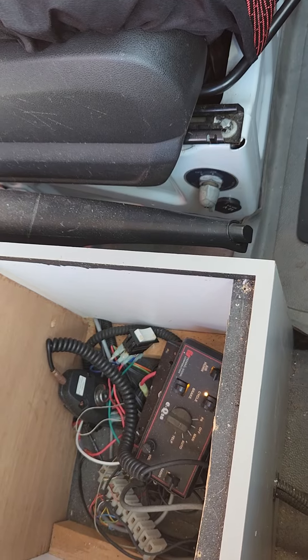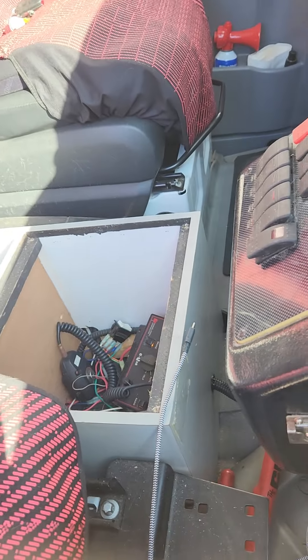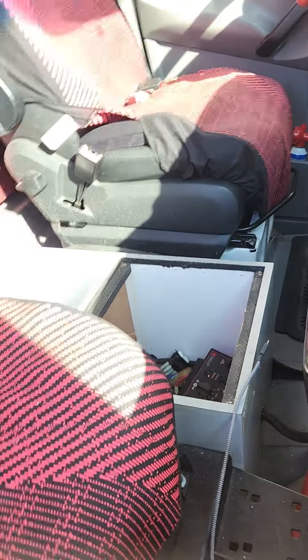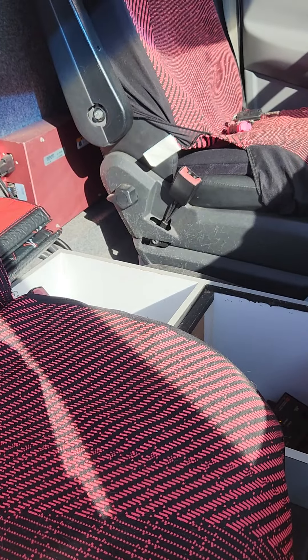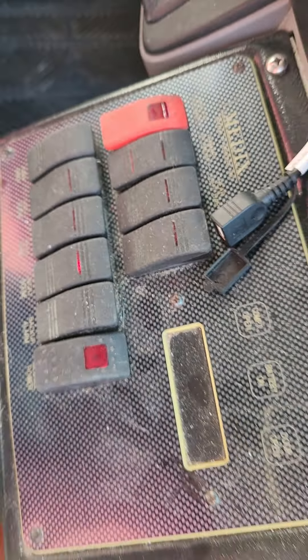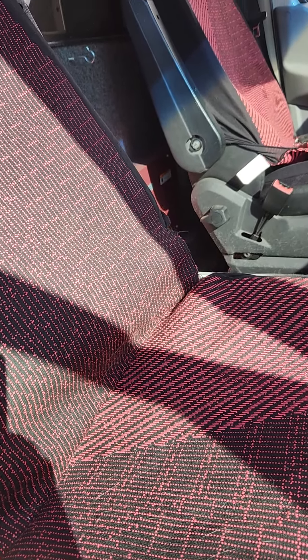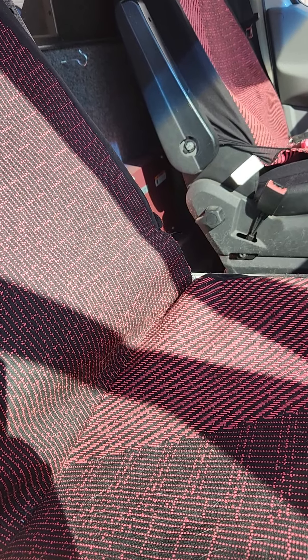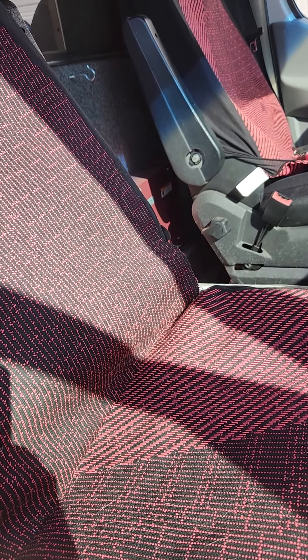Let's go up front so I can show you what I'm talking about. Up here — this is your master power right here, and this is your module power. If your module power is off it doesn't supply 12 volts on the inside; when your module power is on, you have your dome lights and all the other stuff wired in here. That switch disconnects the battery under the hood, so this switch needs to be on and this needs to be flipped.